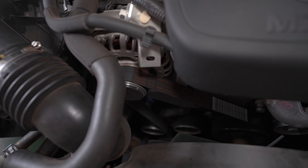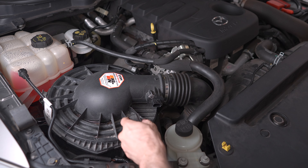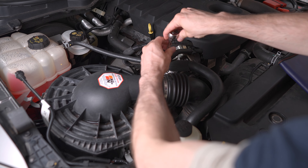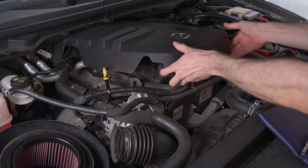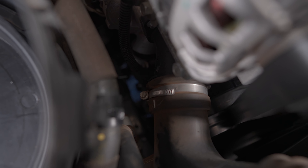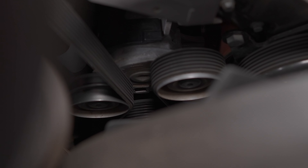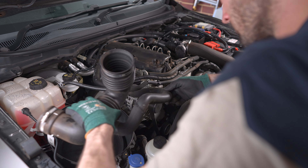Here's a look at the serpentine belt so you're familiar with the way it goes — that's the air conditioner and water pump. Disconnect the airflow sensor, there are 3 clips for the airbox lid, and use a 7mm socket or flat head screwdriver to loosen the air hose clamp. The engine bay cover just pops up — there are 4 clips in either corner — and then the other end of the hose has another band clamp with a 7mm socket or flat blade screwdriver. This is the half inch tensioner down there, so we want to get this pipe out of the way. Just loosen it off and leave it connected — I'll just put it in the airbox.